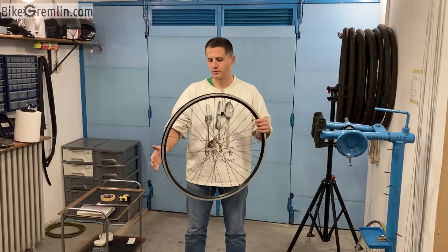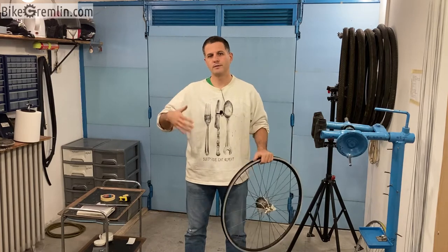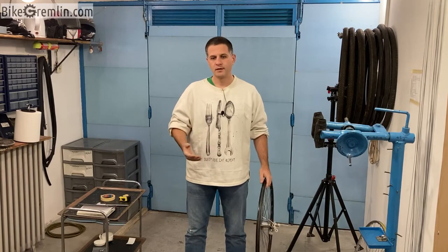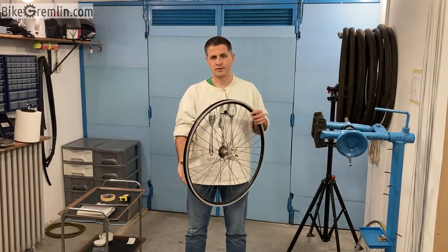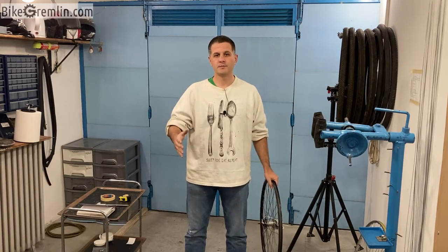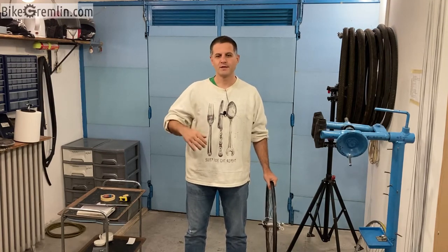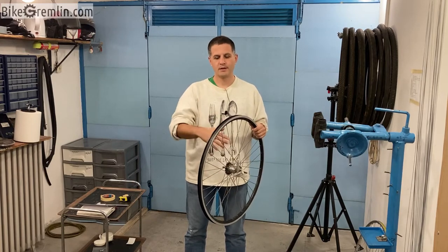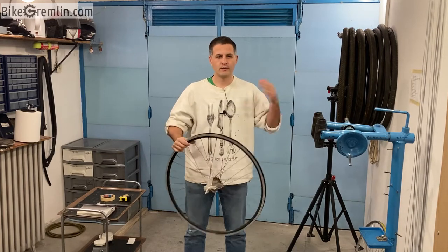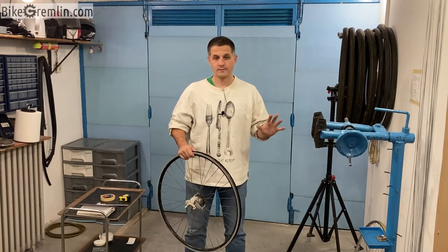I won't be able to reuse the old spokes. The problem is that sometimes it takes a month or longer to find spokes of the optimal length. So in practice, it is a lot more convenient to measure the effective rim diameter of a built wheel, then measure the new hub and calculate the optimal spoke lengths, get the needed spokes, and only after I have sourced the spokes will I completely disassemble the wheel and build a new one, because the old one will keep running while the spokes are being sourced. Okay, I hope I've explained this properly.